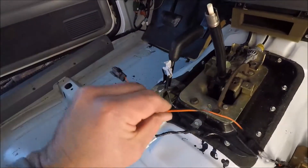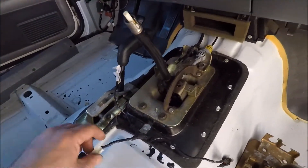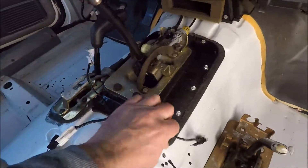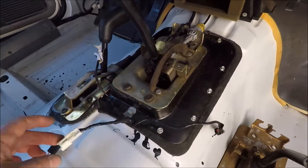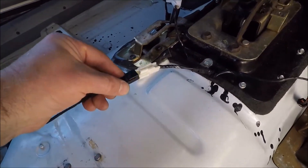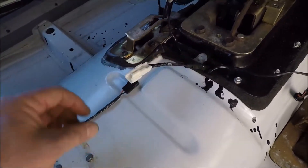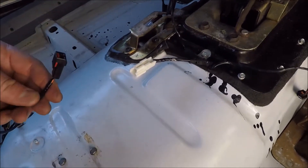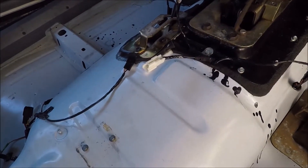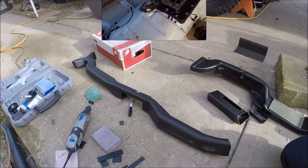Two wheel drive vehicles do not have a transfer case, so they do not have a secondary light for it — it is just a single light for the shifter level. Since I had a donor, I stole the one out of the 98 that has one for the transfer case and one for the other gauge cluster. They wouldn't keep the same plug — that would be really handy — so I'm basically just going to cut and splice, take the other connector off, and splice it onto this wire so I can still plug it in like the factory did. Not a big deal, but just something else to consider as you're going through this process.